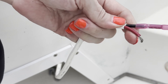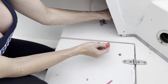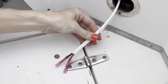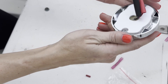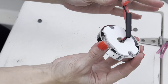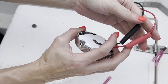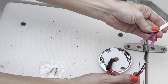Now we're going to do the same thing to the other wire, then feed these wires through the hole and connect our light. So this is our new light — these are a little different than our old lights. It came with this kind of padding to the back, which we're hoping is going to help seal out the water from getting in. We've put our heat shrink on each of our wires and we're going to go ahead and connect the back of the light into the wires of the boat.